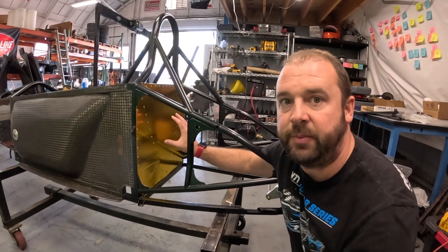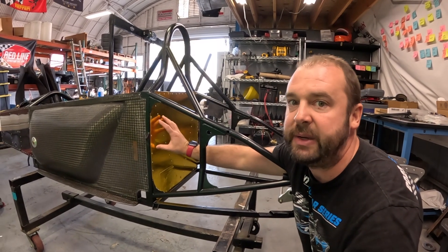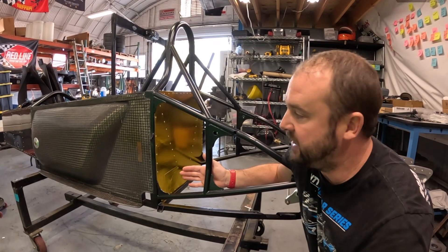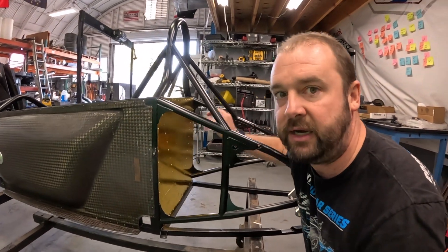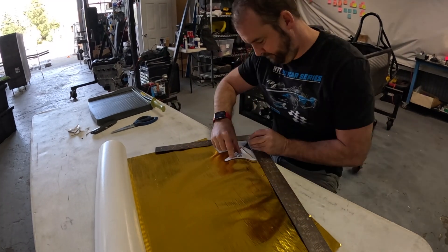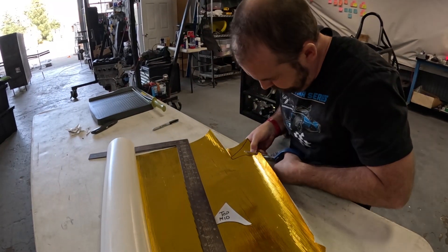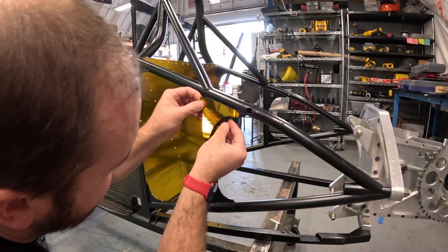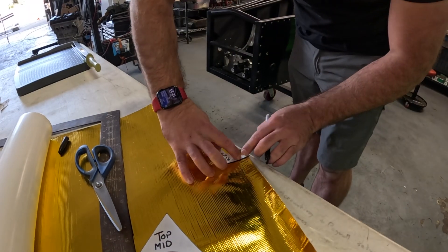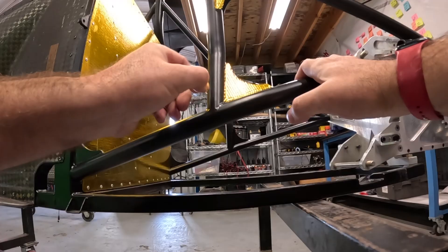So while we're running the Suzuki Hayabusa, the exhaust is going to come out at the front of the motor. We've already got gold foil on this panel here that's going to separate the engine bay from the fuel cell, but we're also going to need to protect some of these bars because the exhaust is either going to come out through this space or the space on the other side depending on what racetrack we go to. To get started on the gold foiling, I really don't need a lot - I've got a right angle square, pair of scissors, a knife, and this cutting board. I've got the gold foil, and before I started this video I tried my best to start making templates. There's no better proof that I've got a little bit of OCD rather than I've got templates cut out for the gussets and some of the radiuses for the tubes that I need to cut.